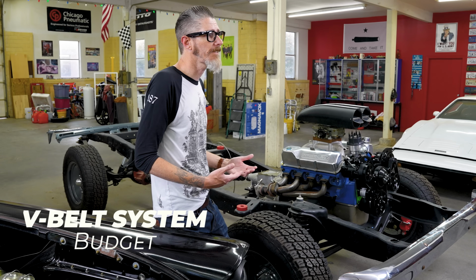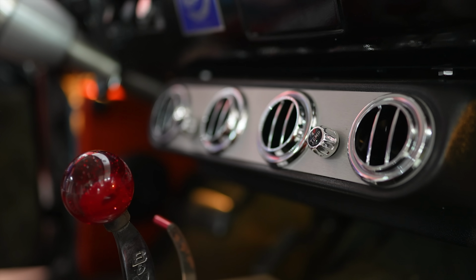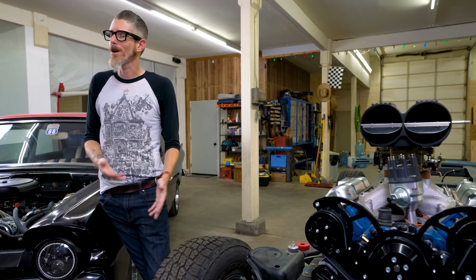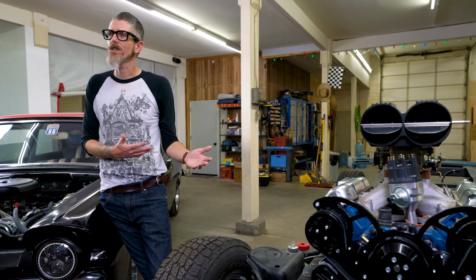And then even a few years after that, I did air conditioning, which we just did for the Route 66 video, which came out fantastic. I really like this system because I was able to have that flexibility of changing it up over time. That's not to say you can't do that with the serpentine system. That option is available, but if you're doing it a little bit at a time, you're probably not going to buy the most expensive parts. V-belt kits tend to be less expensive than serpentine. It's a lot easier for me to spend $300, $400 at a time than it is to spend $2,000 at once. So that was my main factor for using the V-belt system.